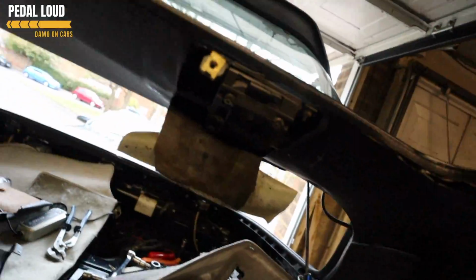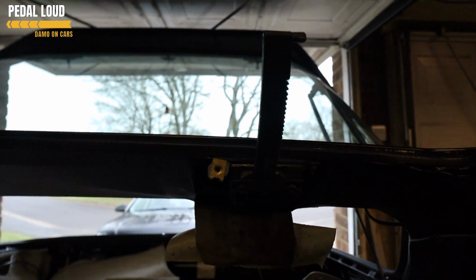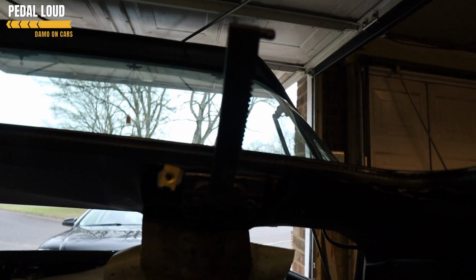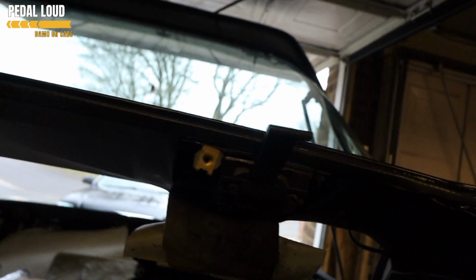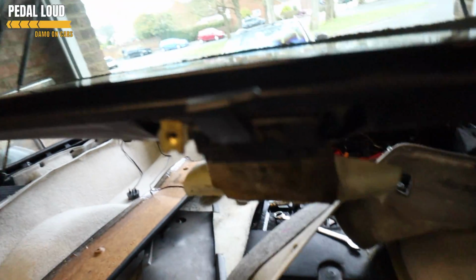And what's going to happen is we're going to push the sunroof button. The arms are extending all the way up and they stop. This is in the sunroof tilt position. We are in ignition position 2, so we've clicked the ignition 2. Okay, we should hit the other side of the sunroof switch and it will go down. The arms will stop there. There, that's what you want.